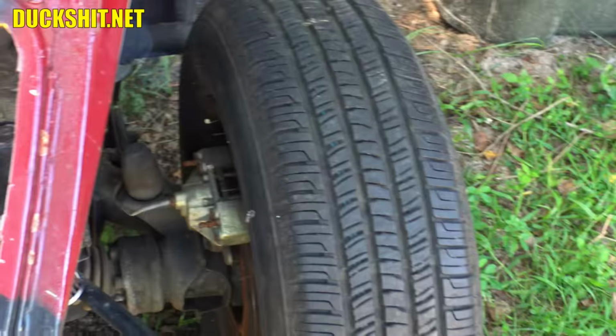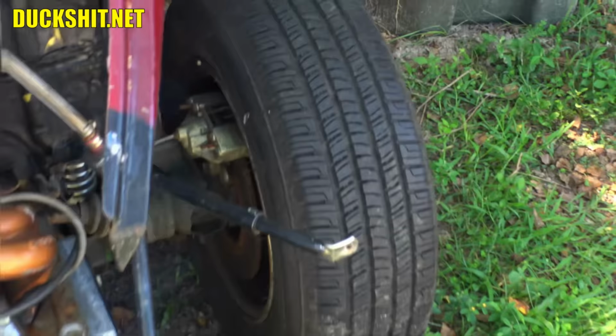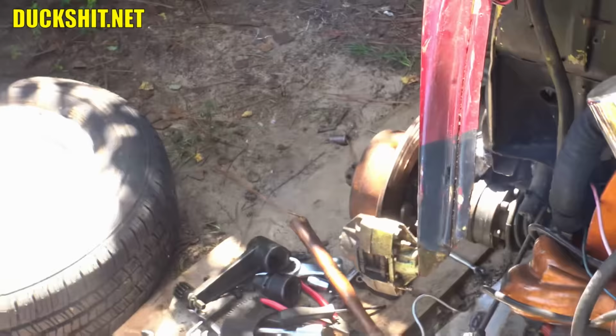the axle nut, because if it's on the wrong side like this one is, or was, that's the reason why the brake caliper wasn't seating properly on that disc. In fact, I was wondering if it was working at all. Everything was just wampus. Everything was just all kinds of crooked. So this side, I don't know. It looks like it's biting into the rotor properly. It has an even wear pattern on it. That side did not, and not at all. So anyway, we'll fix that.